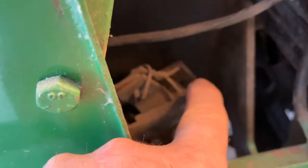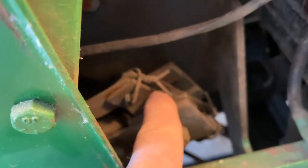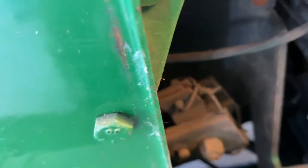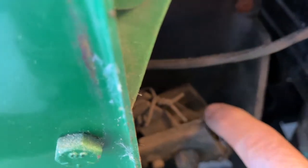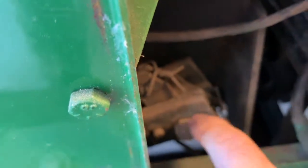Four little pads on both sides of this plate here — it acts like little brake pads. Right now you can see it's loose enough that I can wiggle these pads, so it's not squeezing this middle bar here. It's like a two-piece bar, so it's not going to hold it in position. You don't want it too tight so you can't move it, but if those were squeezed up a little bit, you would be able to keep it in one position. There's a pad right there, one here, one down there, and one on this side, so it kind of squeezes it in four points.